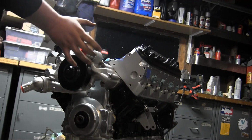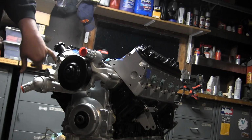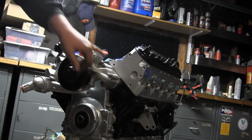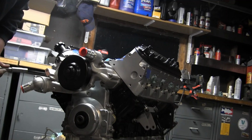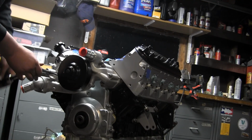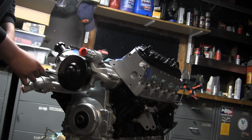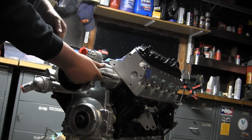I've got all the bolts in, the gaskets up, and them just snugged in. What I'm going to do is they kind of make a V shape on both sides. I'm going to start with the middle one on both sides and then make an X pattern across. What this is going to do is make sure that everything is sealing evenly. And then also, this water pump has 2 different steps that it wants me to tighten bolts in. So first pass is 11 foot-pounds, which you'll see me do here.